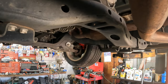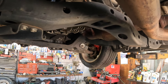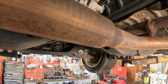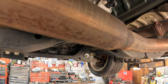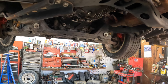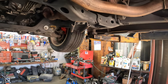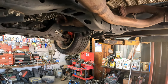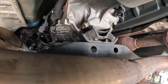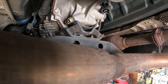It looks like there's a little bit of oil leak up there — it might be a rear main. We'll see, and if it is, we'll go ahead and change it while we're in there. To be honest, we might change it anyway — it's just good practice whenever you're taking the transmission out. So now that you know it is a 27, you can pull that out. When it comes to just a dribble, I'll put the plug back in, then I'll bring y'all back and we'll start pulling the exhaust supports off.